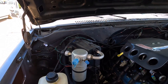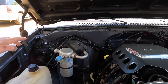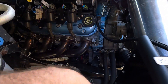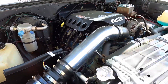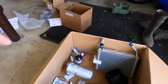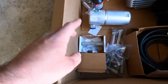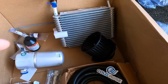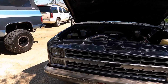So what I'm working on today is the AC. I've got a brand new accumulator, a brand new evaporator, all new hoses and fittings and adapters — the whole nine yards for this thing. All through BP Automotive and Cold Hose, I ordered everything. Obviously the evaporator, the accumulator — it's all my Cold Hose right there. There's my adapter for my transducer for my fans, and all my fittings that I ordered.